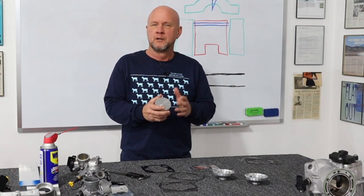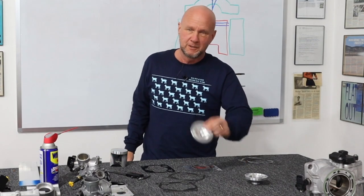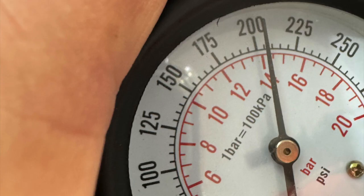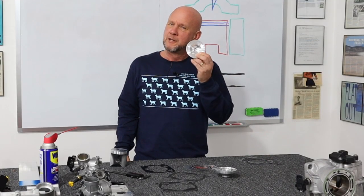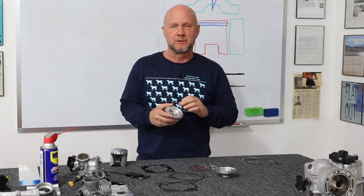That was a good solid 2 horsepower, a little over on the top, down the back side, even better up top. And all that really was, was switching from the stock head insert, which was running 205 psi down here at 100 feet above sea level, to a lower compression head insert that we made, changed the angle slightly — that helped — and that took the compression down to 185, as you see here on the gauge.